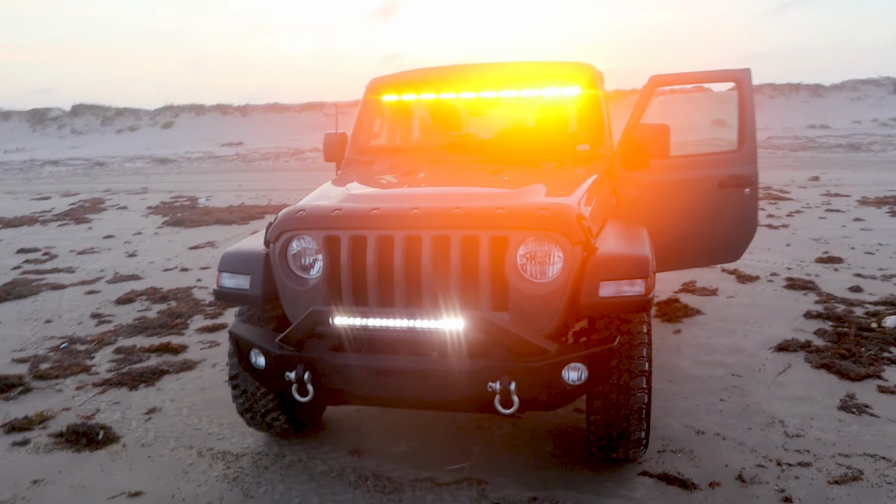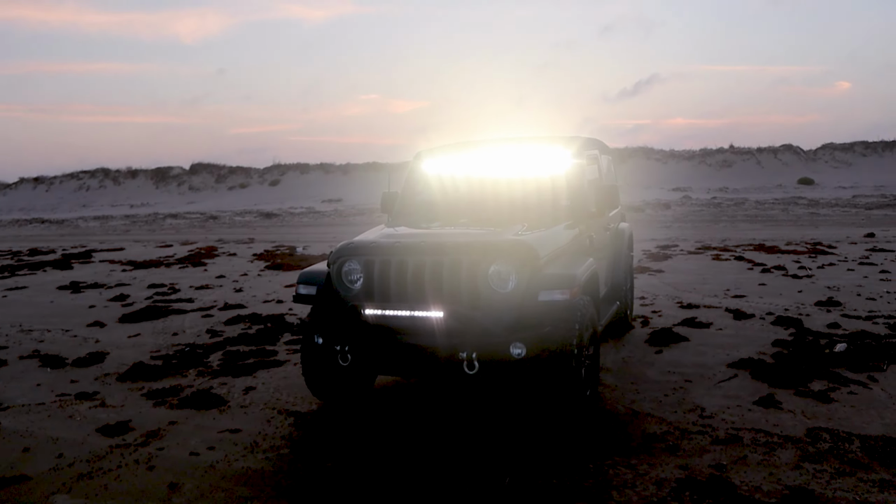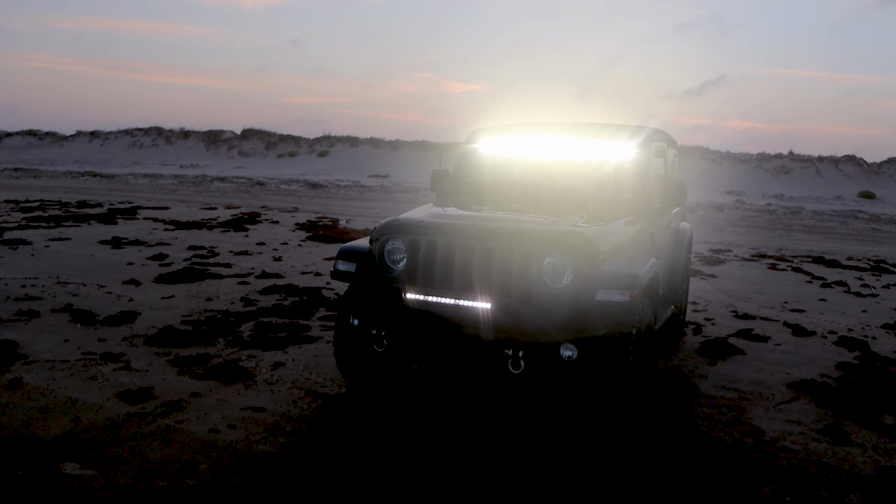And I actually blew a fuse when I was screwing the bolts back into the A-pillar. I guess it hit one of the wires, the ground wire. And so after I got everything together and went to turn it on, it wouldn't turn on. And I was like, oh my gosh, this ain't good, because it's not easy taking all that apart. But I replaced the fuse with a 15 amp fuse, and everything works good. And that shows you how bright the white is up there, guys. It's pretty damn bright.